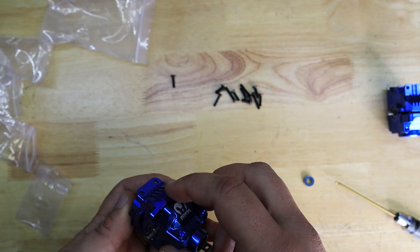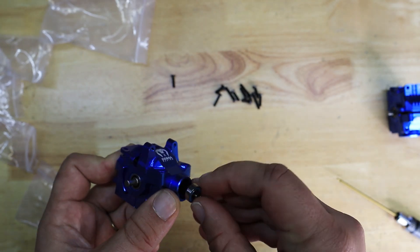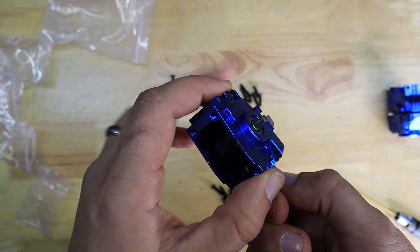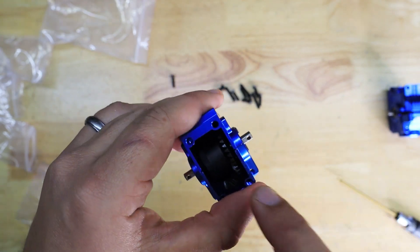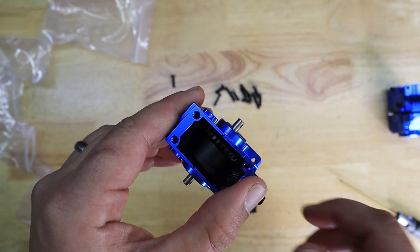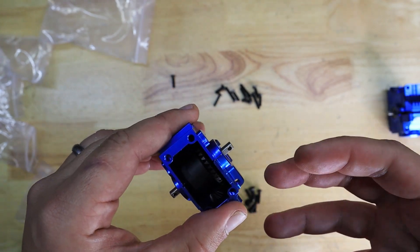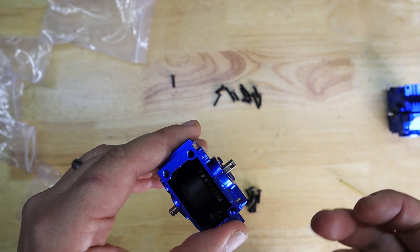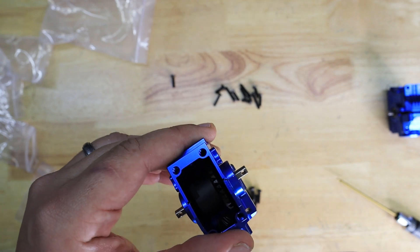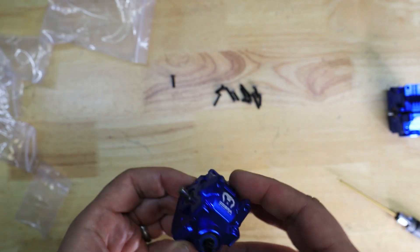The last step — take the other bearing and this one goes in the front of the front differential, just like that. Once you put it in, pull the output gear out. The difference between the helical spiral cut and the straight cut is just night and day. Even when you spin it by hand you virtually hear no gear sound — this thing just spins like butter. With helical gears, because the teeth are angled, you get a lot more meshing, so everything meshes nice and smooth. When you're riding your car with these gears it's going to be a lot quieter than traditional straight-cut differential gears.